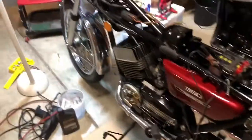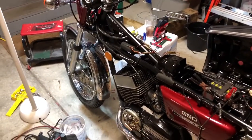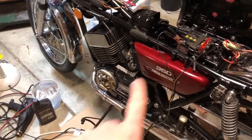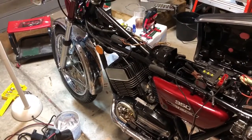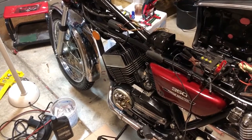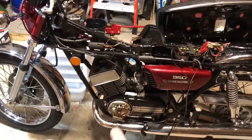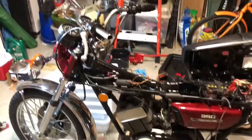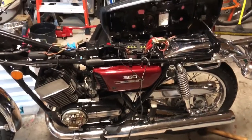Going to try to get the headlight in there with the rim and cut the screws. Tomorrow I ordered some two-cycle oil to fill up, and I'm going to put in the gear oil and the engine oil. Maybe get the tank on, put some gas in, and actually fire this thing up. Then I can do a tune-up — get the points, get the carbs set, and get this wrapped up. Still lots of little bits and pieces, but that's where we're at.